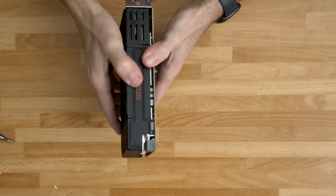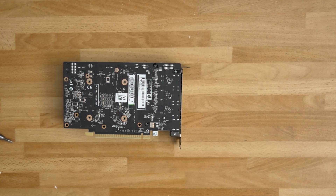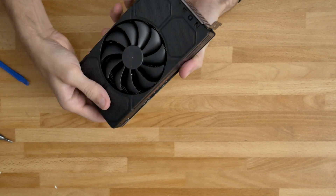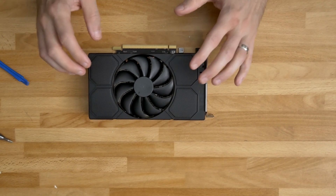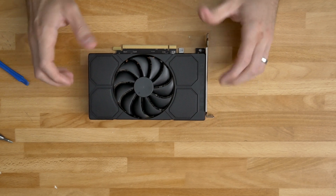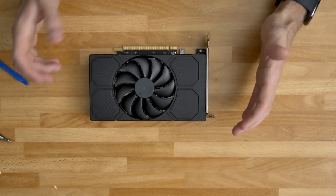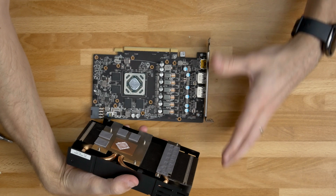I'll give this a little wiggle here to free it — there we go. I think thermal pads were holding us back. What I'm really interested to see is how the thermal pads look on this card, because what you probably already know about some OEM cards is that while the coolers are usually decent for the actual GPU core itself, often the memory modules or the VRMs are not really cooled in any active way. Some OEM Nvidia cards specifically had an issue where the RAM modules had nothing cooling them — not even thermal pads connecting them to anything.